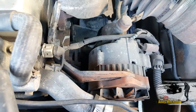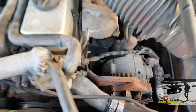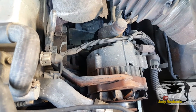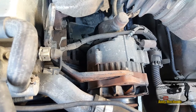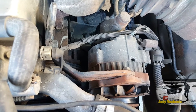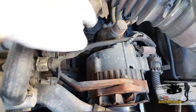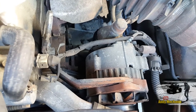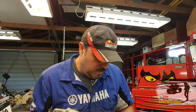The alternators for these Nissan Patrols on the old 4.2 diesels is located on the left-hand side of the vehicle, and it's really easy to get to, which is basically why I'm just going to swap that alternator out rather than do any more tests. I'm pretty confident this alternator has now died. Now on the back of the alternator on these diesels is the vacuum pump, because obviously we can't take the vacuum from the intake manifold on a diesel. I spotted this off the cuff — it sort of just happened, but I thought, hey, make a video about it.